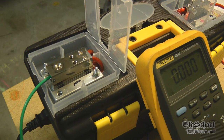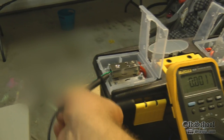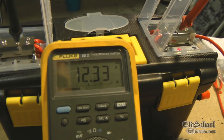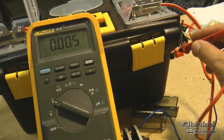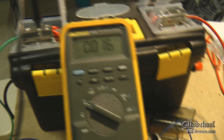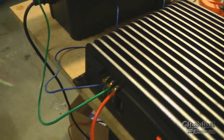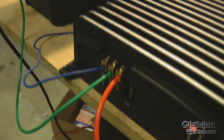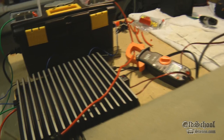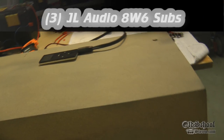The project is complete — you can hear the fan running inside. The voltage is reading 12.33 volts, and on the side terminal for the turn-on wire it's also 12.33 — she's working! Now let's try it with this Kicker ZR240 amp. We have the Kicker ZR240 hooked up, we have power — I'm only using 12-gauge wire because this amp only has a 30-amp fuse. Let me turn the microphone around so you can hear the subwoofers — these are the JL Audio 8W6s.